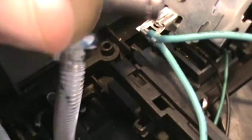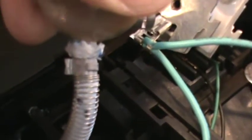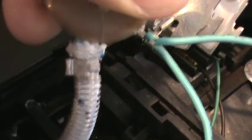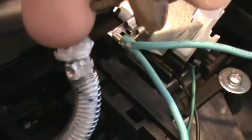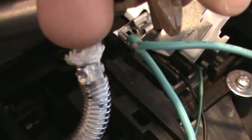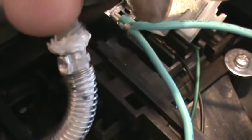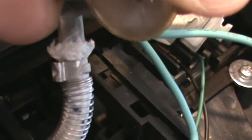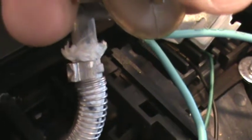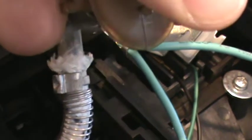Okay, I just got off the phone with the Whole Latte Love tech support concerning the removal of that clamp and getting that steam hose off. I did not receive that clamp with my order, so be sure you ask them to send you that clamp. That is a one-time use only clamp. So I will have to remove that, and the tech support said I could get from any auto parts store a fuel line pinch clamp.